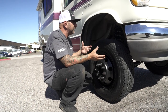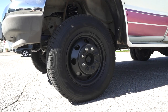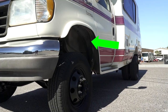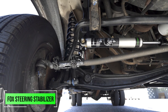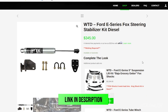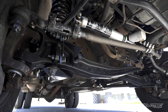This is a diesel van. You can see that it got our coil springs, our Fox shocks, our extended radius arms, and just a mountain of room back here in this wheel well — so when you do go to that bigger tire you'll be set. Now, if you're going to add a steering stabilizer to your Chinook or diesel van, make sure you order the diesel one. It does require some welding in order to install it, but that thing is buff and looks really nice.